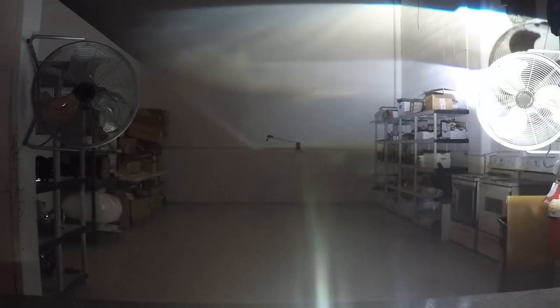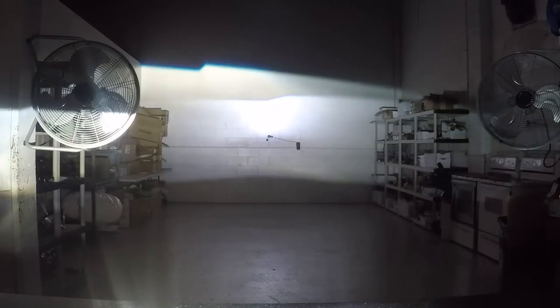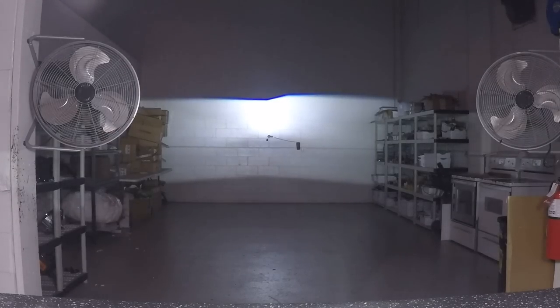The biggest thing about the color is the warm-up time and the fact that the color is never going to change on the LED unit. The HID system is definitely a little bit wider. The intensity — I measured about 556 lux from 32 feet on the new MLED, which is tremendous. And out of this HID unit, I actually only measured about 440. Big difference there.